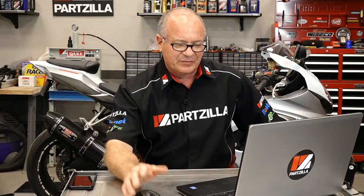All right, Dennis is asking me, I have a 2004 Sportsman 400 that has an intermittent squeal in the front end when you apply the gas, even with the hubs disengaged and before the wheels rotate. Really? That's interesting, because when I first started reading through there, I was thinking a bearing, because typically when a wheel bearing goes bad, they actually start squealing, and it's a very distinct metal grinding sound that you don't easily forget. But you're saying that it's before the wheels rotate, and you're sure it's coming from the front end? I mean, that would imply that nothing is moving yet, and yet you're hearing the squealing sounds. That makes me wonder if it's the belt maybe starting to squeak. Maybe the sheaves are starting to get a little bit glazed, and they're starting to squeak when they're trying to engage on the belt. So I'd probably look there first and just listen a little bit more carefully to see if that's indeed where the sound is coming from.